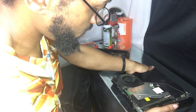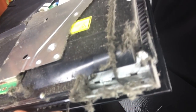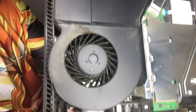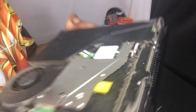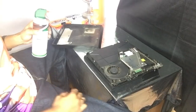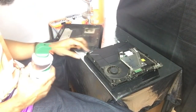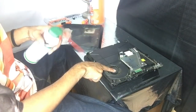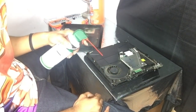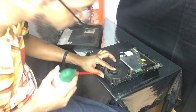Here is my PlayStation — look, dust hanging off. Look at that. That needs cleaned. One of the things I've seen in the videos: when you take your air blower to the fan, hold it down so you don't burn something out when it's rotating as you blow it. So we're gonna hold it down, make sure the straw's in nice and good. Oh my gosh, it's so dusty.